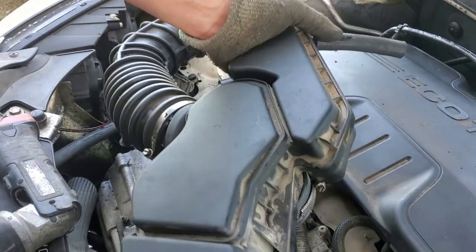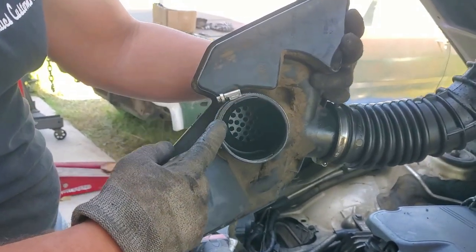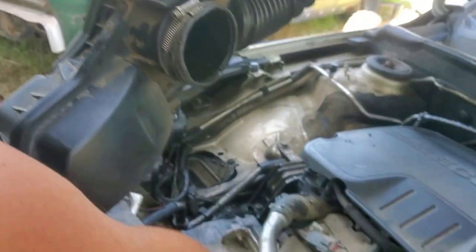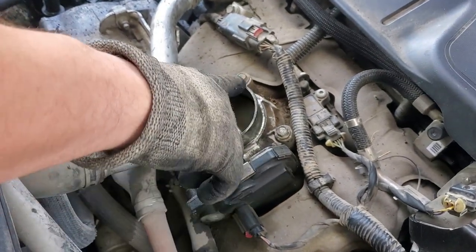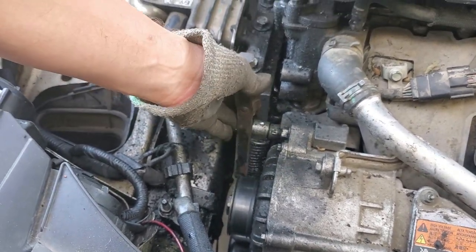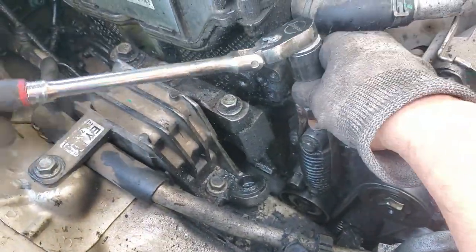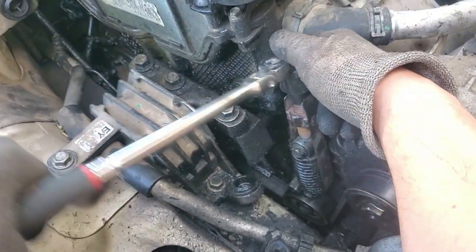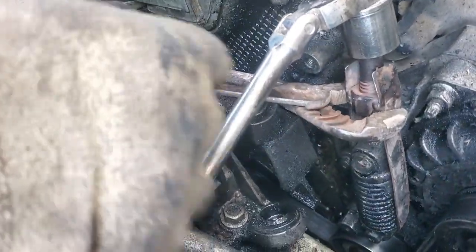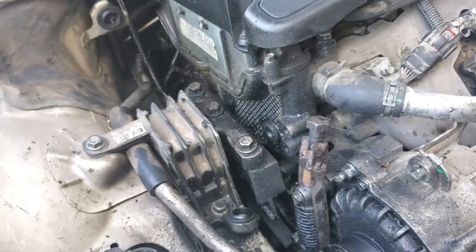This tube goes to your PCV system — the system that clogs up on these cars causing those major oil leaks. This gasket between the air intake duct and throttle body was crushed, not creating a proper seal, which is why I could remove it without loosening the clamp. Here is the homemade tool I made to compress the spring built into the tensioner — very simple design. You could also use a small C-clamp. I used channel locks to keep the tool from going crooked.